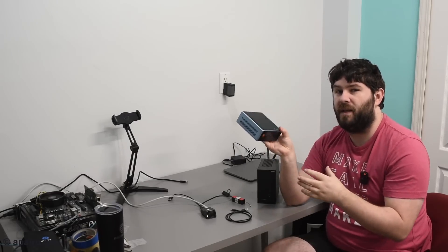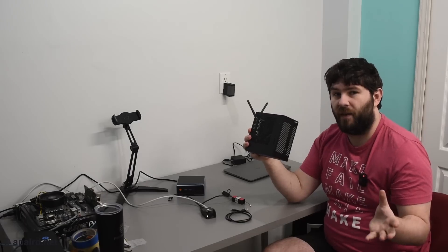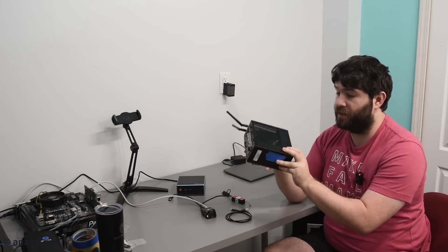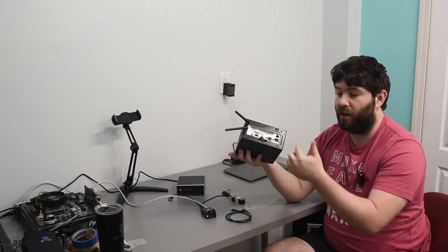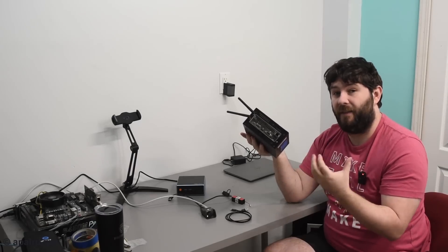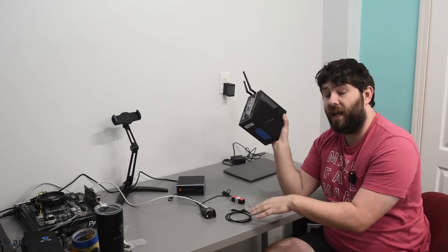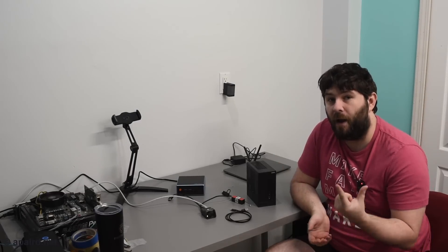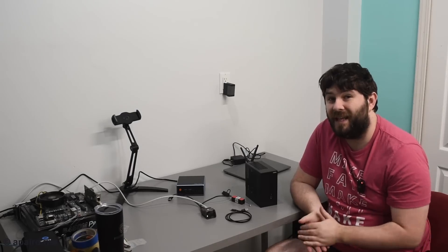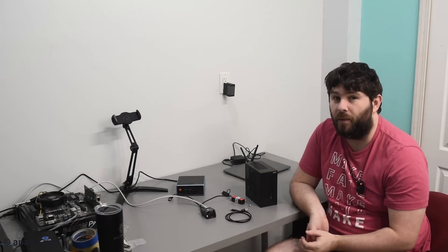That's mostly the limitation of this mini PC having weird port combinations, but it's not entirely uncommon. Here is another mini PC — this is older, a desk mini that fits a socketed Ryzen AM4 CPU and brings out all the Ryzen I/O directly to the back panel. All of the Type-A ports supply power when it's turned off and they work in the BIOS, so with this mini PC I can use the JetKVM with no problems without a power splitter. The solution is to get a powered USB hub, find which ports on your device work for keyboard and mouse — which is not all of them — and plug the hub into one of those ports and power it separately. If you have higher-end hardware with socketed processors, it's probably going to power a lot more things from its standby supply than laptop-based mini PCs will.